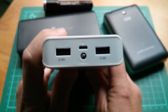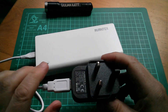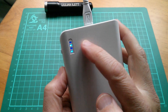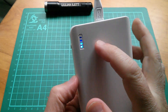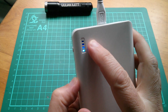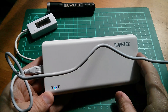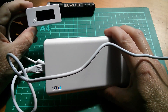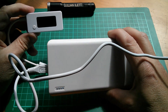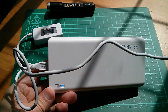I'm thinking this Avantec could become my favorite power bank, as it has the high capacity 20,000 milliamp hours and also smart charging ports. Let's put the Avantec on charge using the supplied USB cable and power supply. While charging, the LEDs on the front light up. My camera's slow refresh rate makes the pattern look irregular, but actually the two bottom LEDs are solidly on and the third is flashing — so it's half full on its way to three quarters charged. I'll leave this to charge, then run a full discharge capacity check using a USB capacity checker, converting from 5 volts to 3.7 volts and factoring in the 90% efficiency parameter.